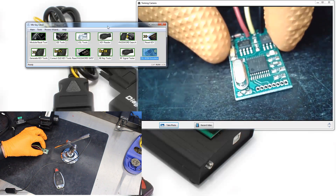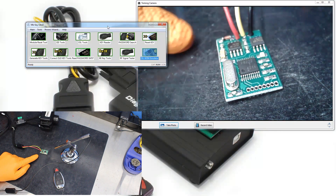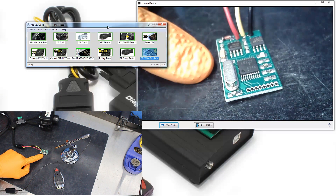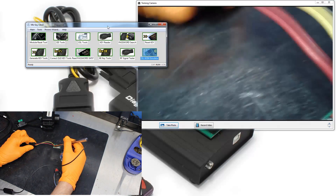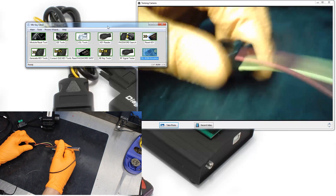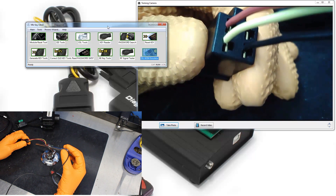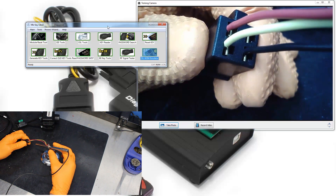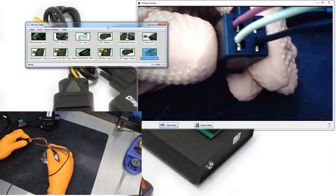We have this little guy right here — very small and it can actually fit inside the EIS housing itself. We have three connections: power, K-Line, and ground. Those are soldered to the board, and on the other side the wires are inserted for programming. The ends have been tinned so they're a little more rigid, and we have them inserted into our bench test harness.